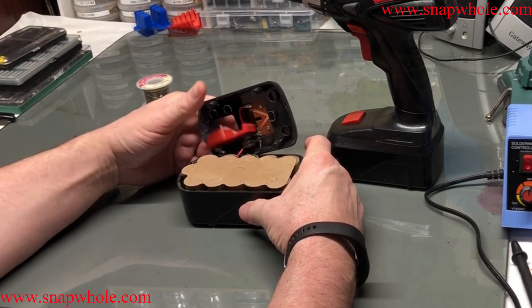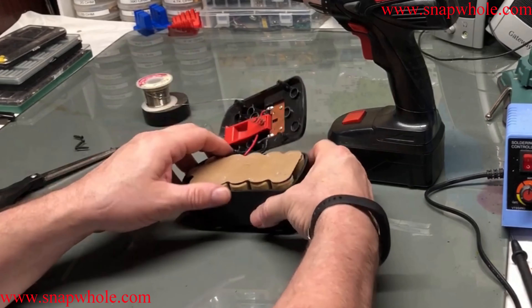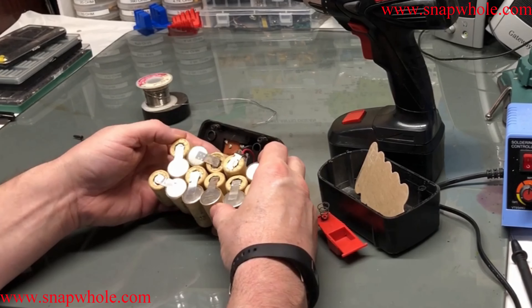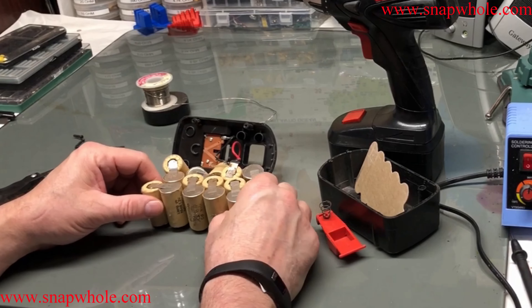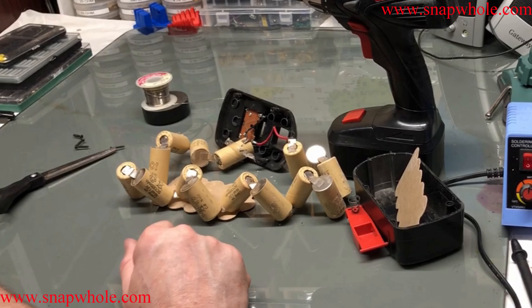Here's the inside of the battery. This is the physical clip, this is the interface to the drill, and here is the battery pack. As you can see, it's really just a collection of cells. A basic battery cell has a 1.2 volt potential, and you can see they've just wired these all together to get 18. So I've got 15 cells — that gets me to 18 volts.